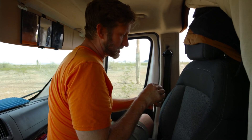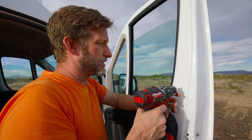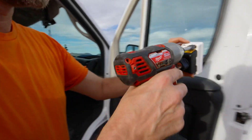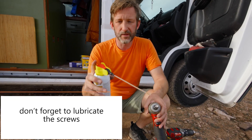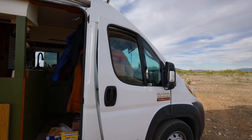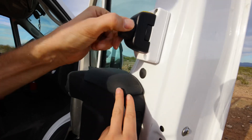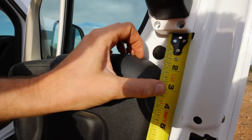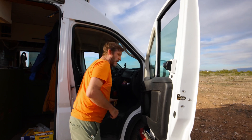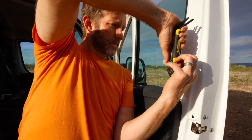Since I can't get a pencil or marker down there, I'm using the punch tool to mark my hole — push it down and you can hear it snap, which puts a little dent in the metal. Drilling holes in the van — okay, ready. The instructions say to squirt a little lubricant or grease on your screw before putting it in, which helps it go in smoother and protects against rust. Before doing the other two screws, I want to verify the position — it's a couple of inches above the armrest, about an inch and three quarters. Then crank down with the allen key.